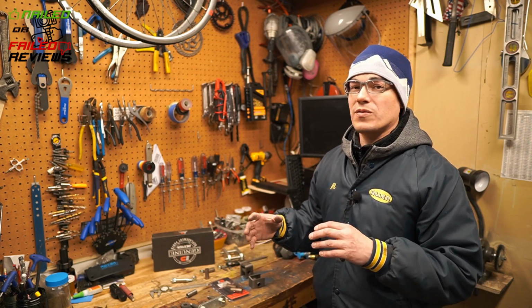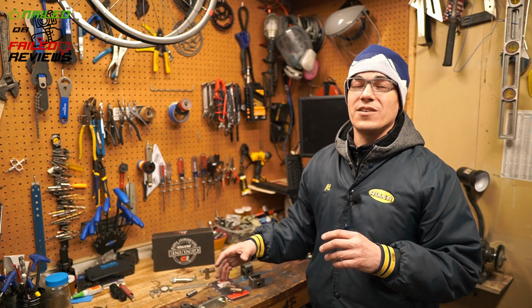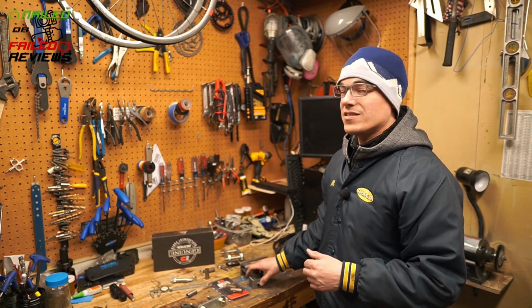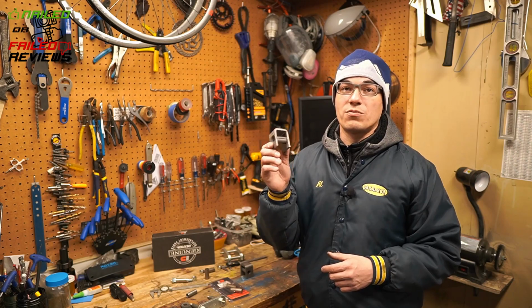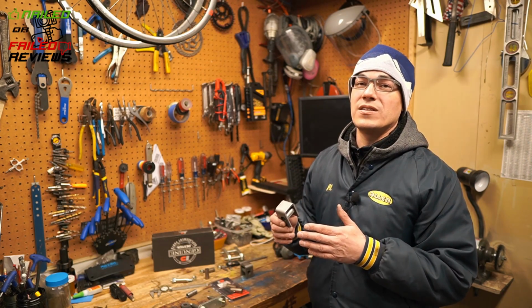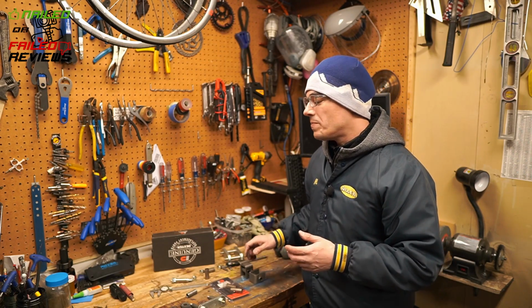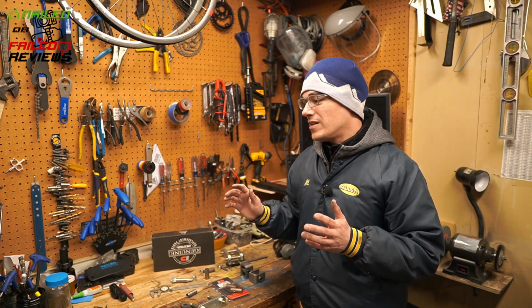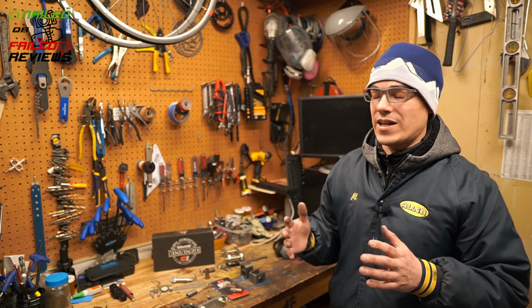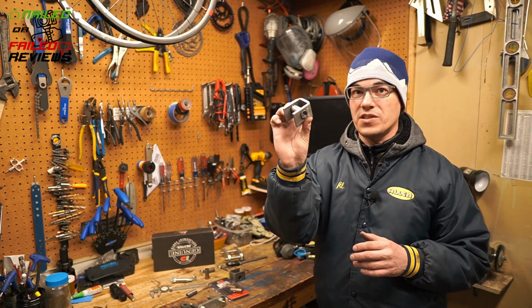If you have a trailer that's kind of 5, 6, 10 years old, and you get under there and you look at it and it's just completely egg shaped, you're probably going to have to take it to the shop and have them cut them off and weld on these new ones. Or like I was saying, they could technically weld in just some material, fill it in, and then drill a new hole. But then you have to worry about, is it perfectly straight and all that stuff that comes with drilling into two separate tabs like you see here.